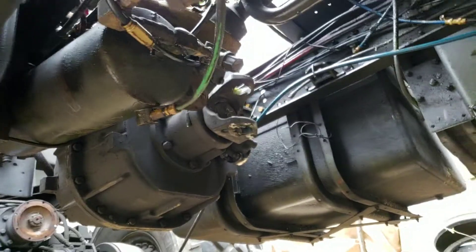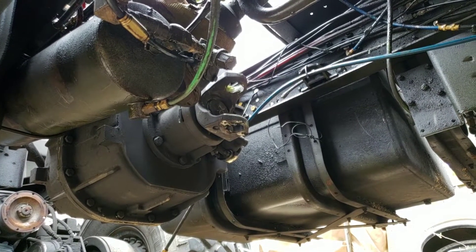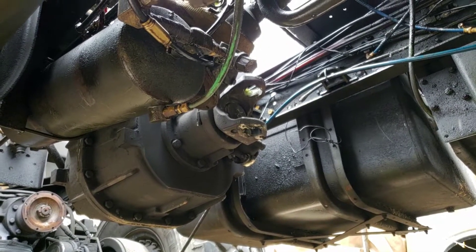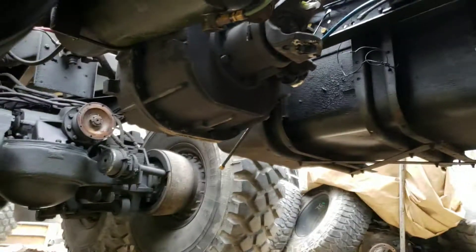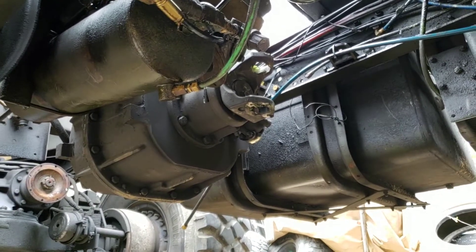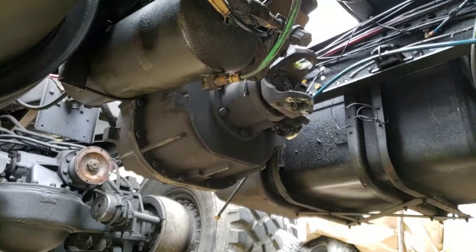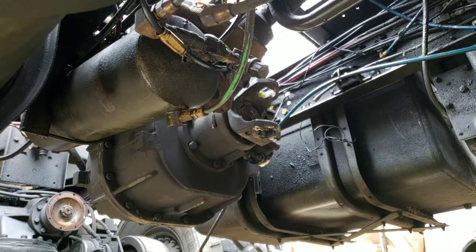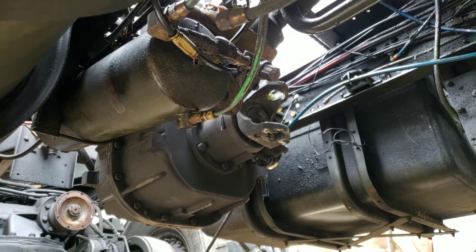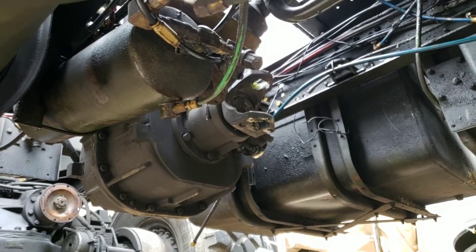This is the HEMTT transfer case: 0.98 high range, 2.66 low range, air-operated front axle engagement. There is also an air-operated high-low engage available to buy for these — it's expensive, so I'll just make one. It does fit. On a normal truck it might fit right in there too. On an A2 truck with a longer driveshaft jack shaft you could probably make it work pretty easily. You would lose overdrive if you didn't have a different transmission in front of it, but this case is designed for much heavier engines and transmissions. I paid $85 for it doing the crate.